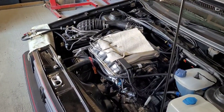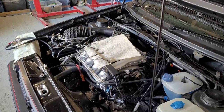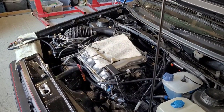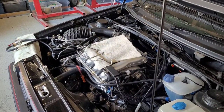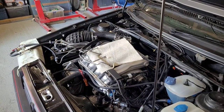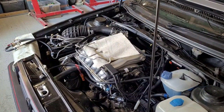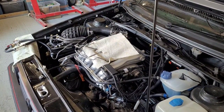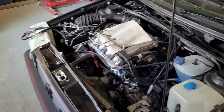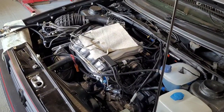We need a new set of injectors. What we're doing is buying the Mercedes injectors - quite a common thing to do. It's a brass injector, same difference. Still opens at between 3.2 and 3.4 bar. The only difference is cost - four injectors for 72 quid to the door, genuine Bosch ones. If I wanted the steel ones with the top hats as are fitted, I'm looking at not far off double that price. So it's just not worth it.